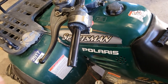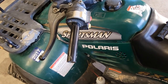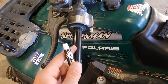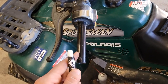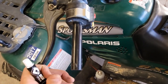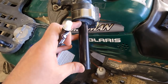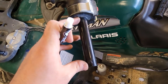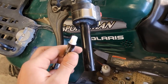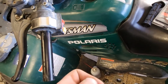Now we're ready to go ahead and put on our grips. So you could do this with several different solvents or glues, but they went ahead and they have grip glue in. I've gotten away with dish soap. If you don't realize, dish soap does dry, and it dries on sticky if you use Dawn or whatnot. I don't know about the organic dish soap and other types of dish soaps, but yeah, Dawn works really well. Hairspray works well if you have some. I don't have any, so we're gonna go ahead and lay on this, and we'll see if we can squeeze